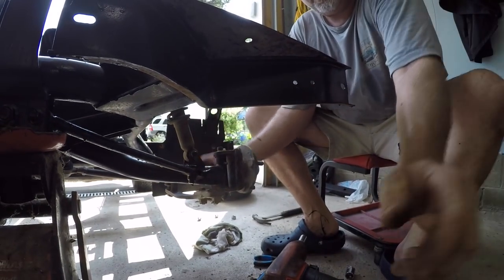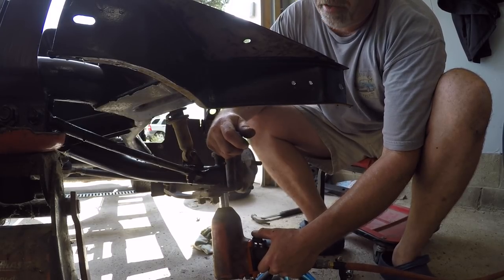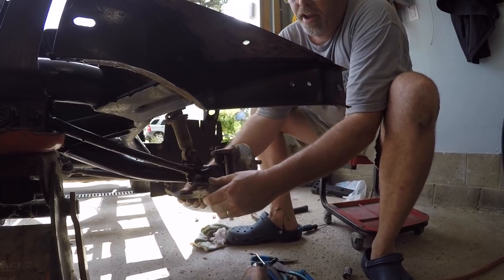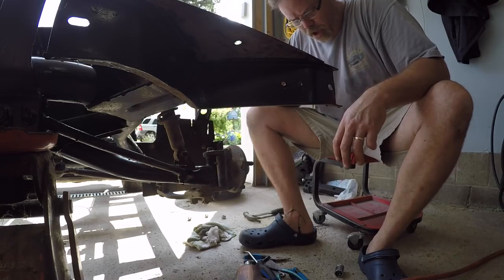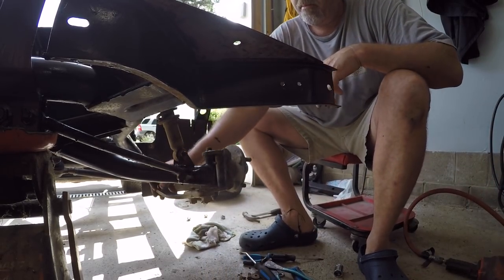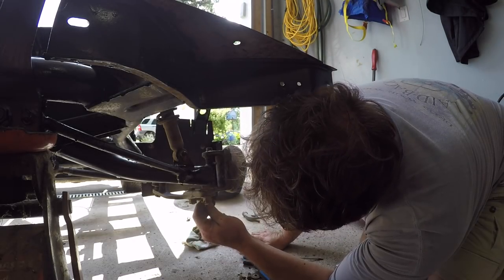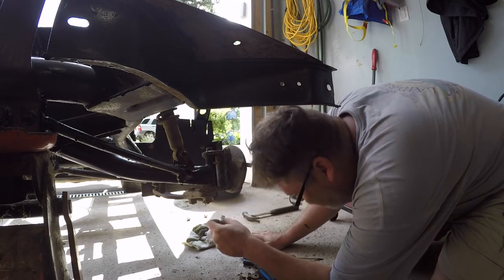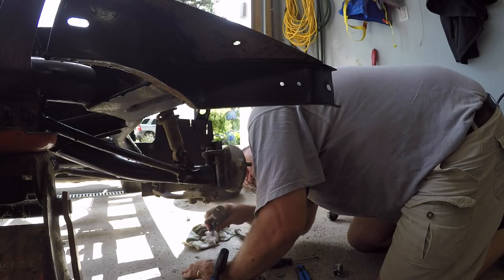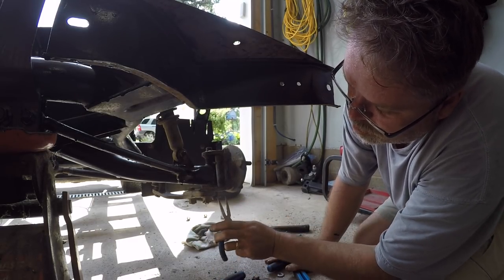So as you can see the top part spins, so there's a hole in the shaft that you can put a screwdriver through just to hold her so you can give her a crank. Now I'm cranking the hell out of this thing, trying to get her tight to the shaft, but yet it's still movable - you want to make sure it's still movable. Look at the difference in that already - big time. So if you ever want to cheat on the old golf cart and don't want to spend any money, take her apart, put some washers in her and tighten it up. Now we've got to put the old cotter pin back in. Tap that back in and try to straighten her so we can actually hit it. Bend the old tabs back like so and we're good to go.